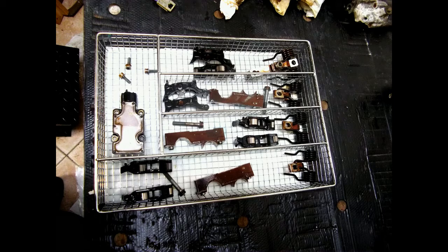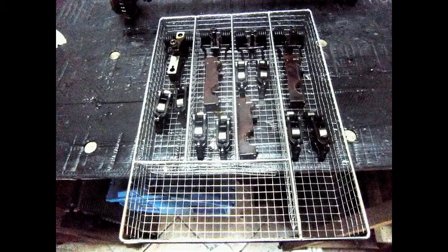After having cleaned these parts, I will dry them off. I also will inspect all the fine oil channels that are in certain parts for blockage or gunk. Some parts are still brown. This is oil residue that really burned into the metal. When it dries, it will even look like the parts are rusted, but that is not true. Because of the bearing journals, I cannot use the sandblaster.